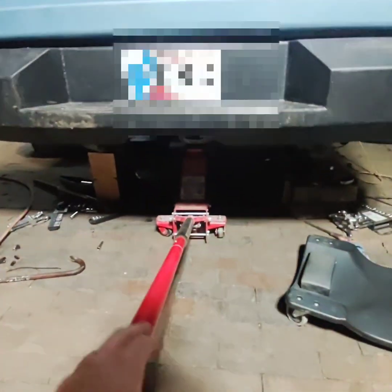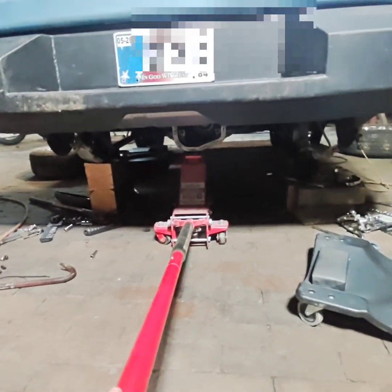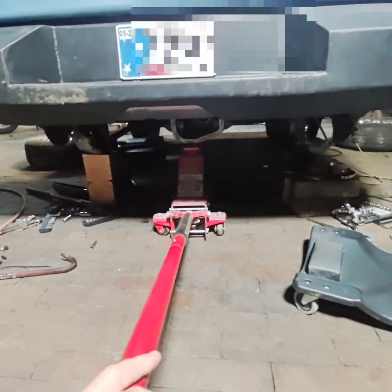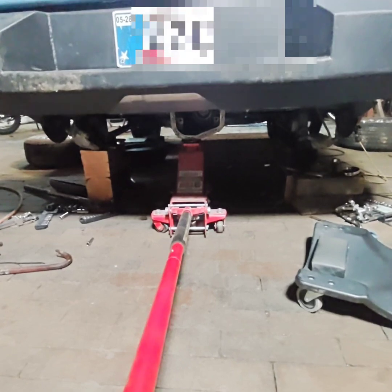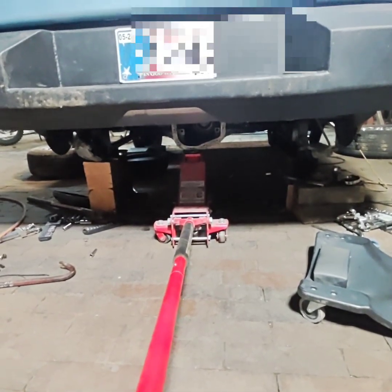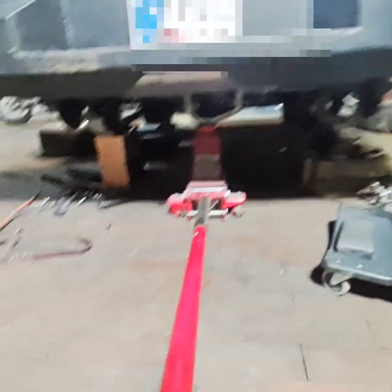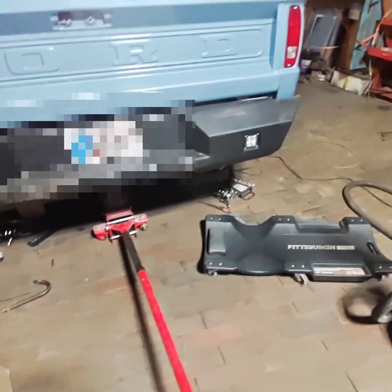So the rear end of this thing is apart because I took it on a test drive to let the transmission learn with that controller, and soon found out I'm a dumbass because I didn't check the fluid level in it, and it has none. I think this was a new axle they put underneath this because there was no leaf spring perches on it. They did a four link, but there was no tag on the axle, and I did not think about it. So the first drive pretty much wiped the rear end out. So I'm going to have to redo that.